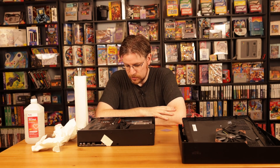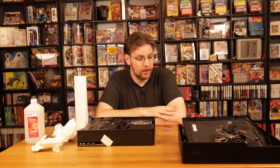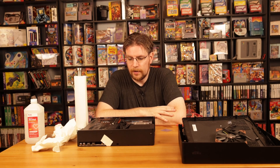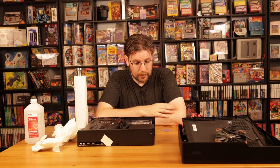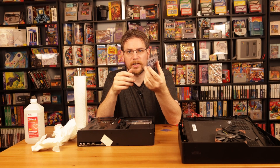This case — a Fractal Node 202 with an RTX 3080 — just straight up thermal throttles. Anybody in the ITX space probably knows this problem: when you throw high-end components into a compact case with very little airflow, you have thermal throttle no matter what. This case in particular is a bad design. Fractal has come out with a newer case that actually has proper airflow — this one did not. If I would have known that when I built it, I wouldn't have bought it. But I am interested in Fractal's newer case — I'll put the model number on screen. Anyways, this is upgraded. I hope you liked this, and until next time — later y'all. Do I really need to say anything about how terrible that packaging was?